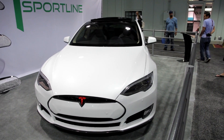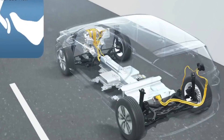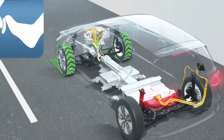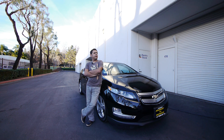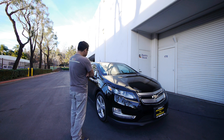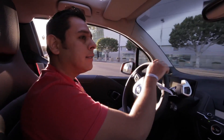Some cars, like the Tesla Model S and the BMW i3, are set to regen as soon as the driver backs off the accelerator pedal, allowing drivers to essentially use a one-pedal driving style. While other cars, like my Chevy Volt, apply regen only when the brake pedal is pressed. Both of these approaches work great, and it takes very little effort to get used to them.